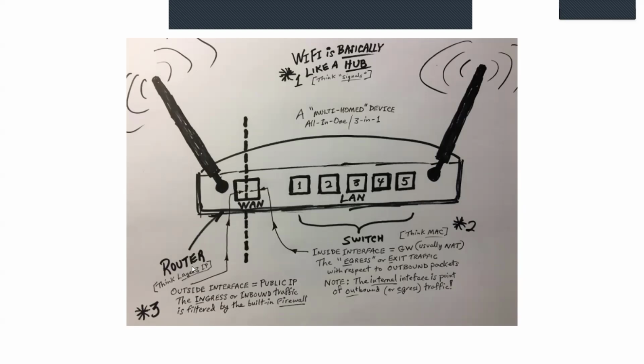Essentially what's happening is that there's an outside or external interface, and there's an inside or internal interface. There's the nasty public internet out here, the wild, wild west, and on the inside is the cool, calm, collected pond of your local inside home network, but it's a single physical port. That can be kind of confusing because the physical shows just a single port, but the connection to the outside internet is virtualized so that it's split in half.